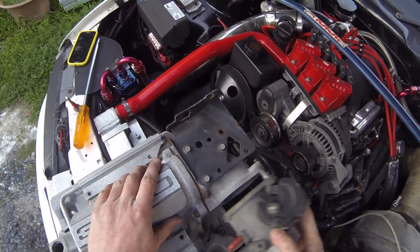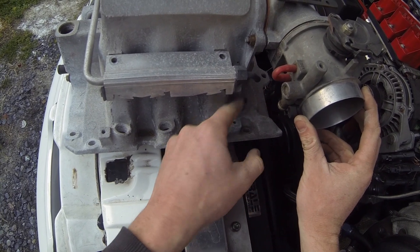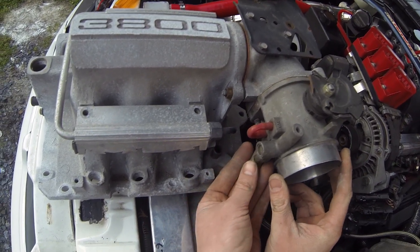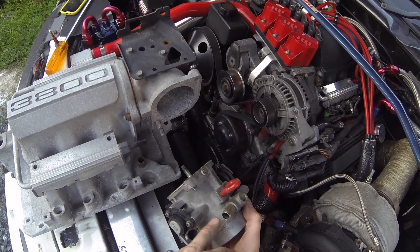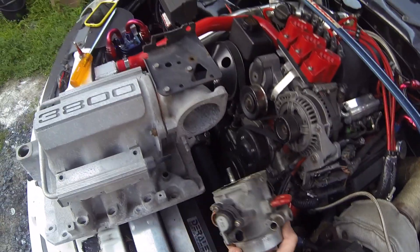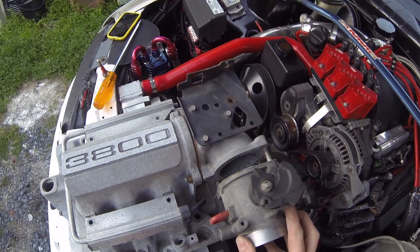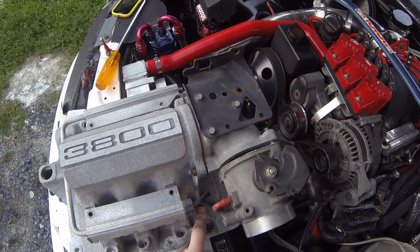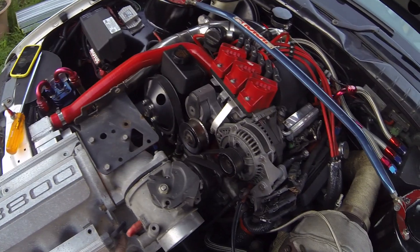As you can see, this port on the throttle goes down just a little rubber S-hose onto the inlet manifold. You need to block off the throttle body. What I did to do it properly, I put a little M6 nut set in there with some sealant, and then I actually threaded in an M6 bolt as well with some sealant on it. But you can get away with just a rubber hose with a bolt hose-clamped in it, or multiple ways you can do it. You must block off the throttle. And then from this port you can either run just a rubber hose with a breather on it and just let it vent to the atmosphere, or you can run it to a catch can.